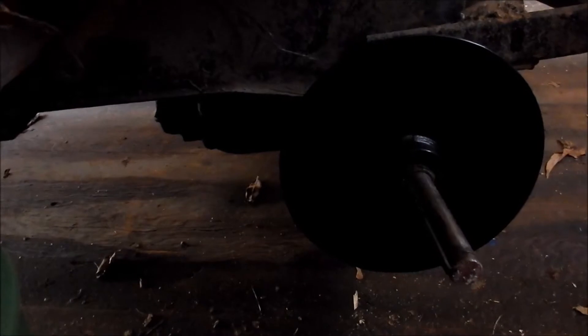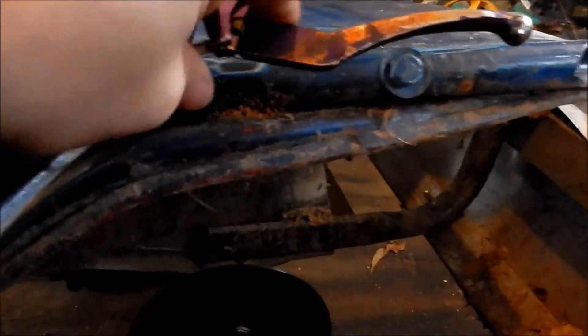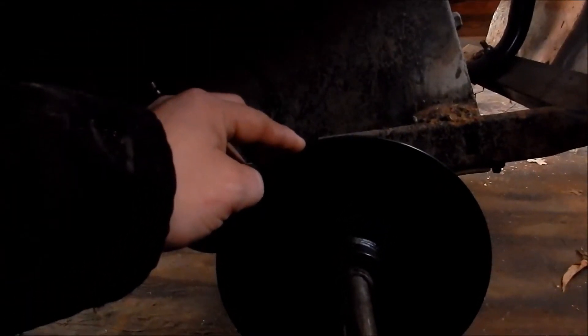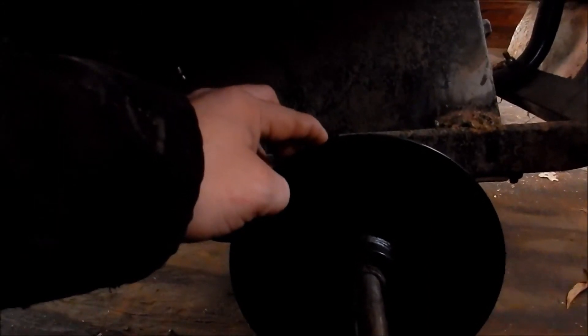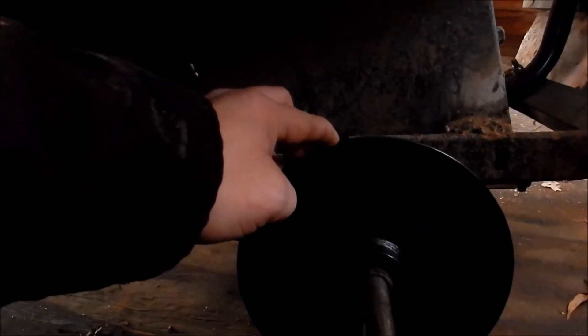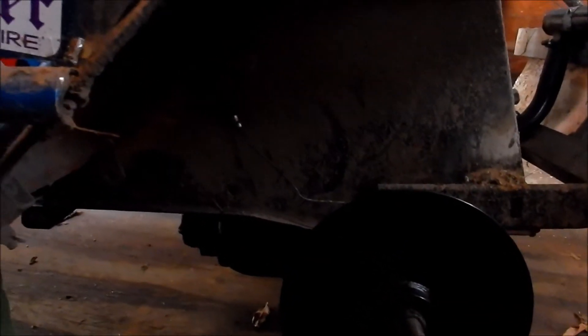The brakes are really easy — grab a brake handle off any bicycle. I like going to junkyards because this lawnmower is made out of three or four different mowers. The brake system is what they call a manual brake system, not hydraulic — thank God, because the hydraulic ones are like $200. I built this mower with about $120 into it and it's got seven wins last season.